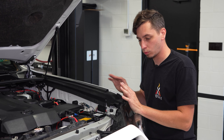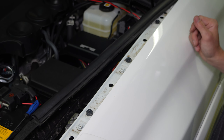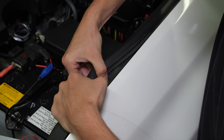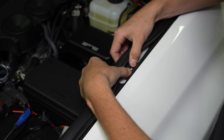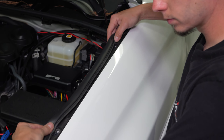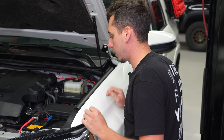We've got everything hooked up wire-wise, so now we can get this piece back on. There's a little trick to it — there are three clips that hold it into place. You're going to put it on top of those clips, move the seal out of the way, and pop the plastic in. Don't move it all the way down or you won't be able to get all three clips in at the same time. Once they're all just about in, pull it forward and that'll get everything secured. Then pop this piece into the fender and you're done.